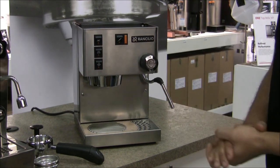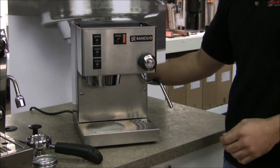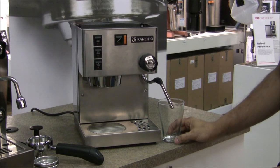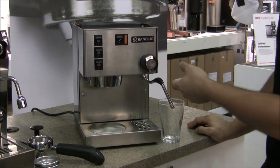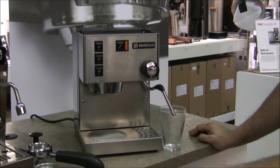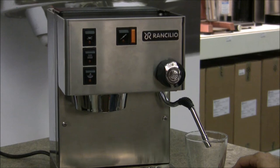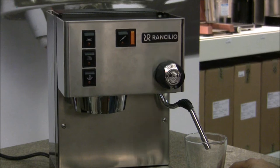What you need to do: you can fill up your drip tray, or what I like to do is have a secondary cup so I don't have to empty out my drip tray — just toss away the cup. Place that underneath your steam wand, then turn on the unit and hit the hot water button after you open up the steam wand. It will pump and it can take upwards of 45 seconds for your boiler to prime. Once you see a steady flow of water, your boiler has been primed and you're good to go.